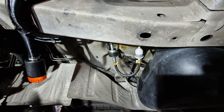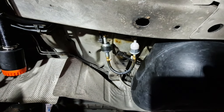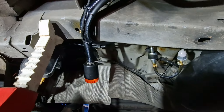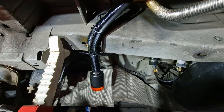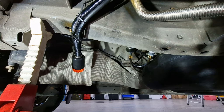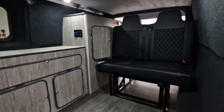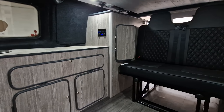I'm happy with that — it's a good install. Everything that needs to be is out of the way of the elements. I checked before in the rain when it was absolutely pouring down and all of that where the pump and filter is was dry. The air filter intake is facing downwards, so if there's any water getting near it, it won't go into the heater itself. Transit Custom under-seat Chinese diesel heater installed — five kilowatt. On the way home I'll put some fuel in and give it a good test; I've got a heat gun to measure the outlet temperature. Current temperature is around 10 degrees — normally within five or six minutes you can get up to 15-20 degrees.